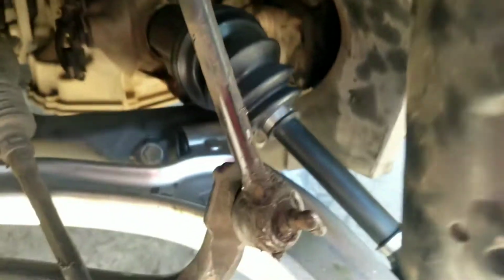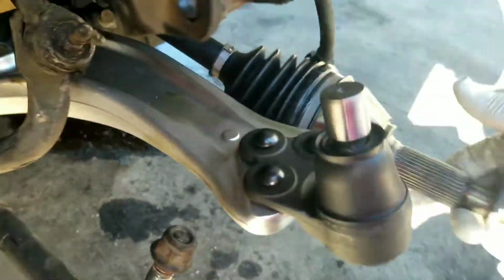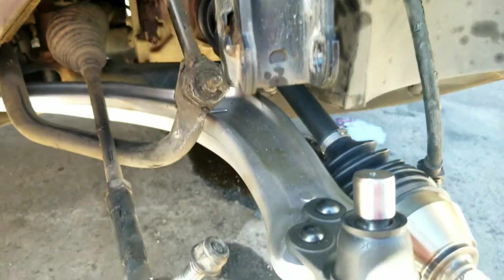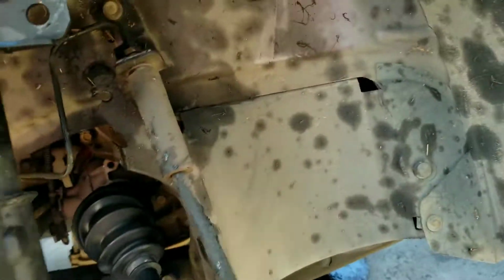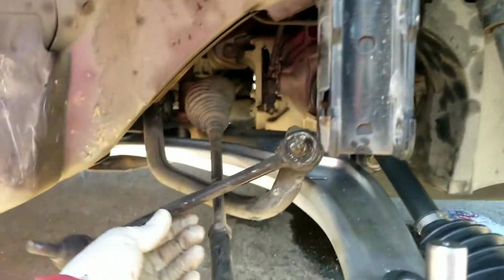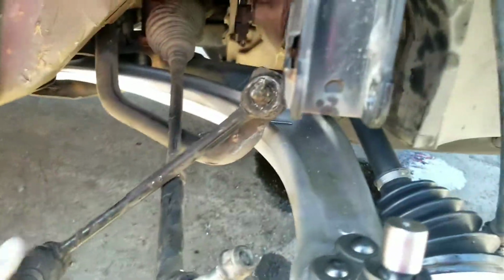Now that's done. On this particular car, we changed the lower control arm, as you can see here, the CV axle, and the spindle. This was a wrecked vehicle. We're putting it back together for the client. We're going to change this strut out as well because it's questionable, and get this car back on the road and ready. We'll also have to bleed the brakes because the brake line was broken there. That's no biggie. The sway bar link will need to be replaced because it's bent, as you can see on that piece there.